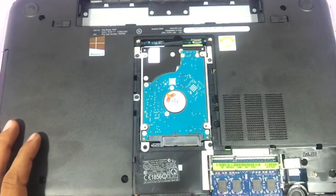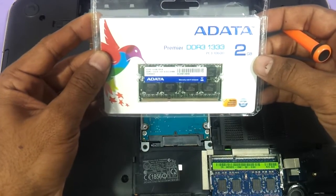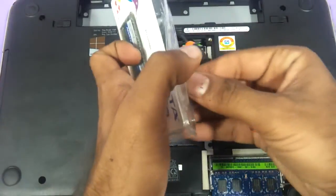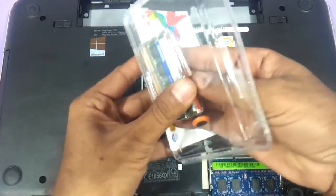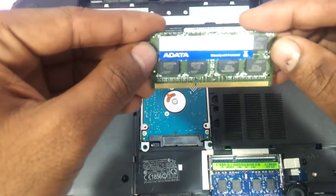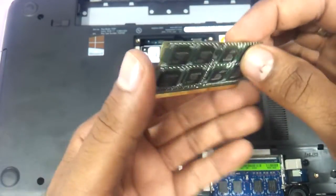So we just need to buy ourselves a 2GB DDR3 SO-DIMM memory. This is a 1333MHz A-Data Premium memory that we have in hand. Let's open it up. This is the way the RAM looks like — it is a DDR3 as I said earlier. This is a 16-chip RAM that we are using, and I would always suggest you to go with a 16-chip RAM.